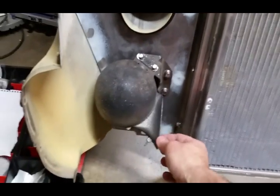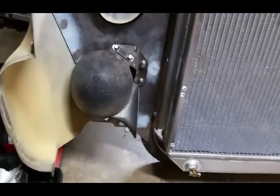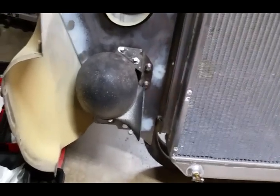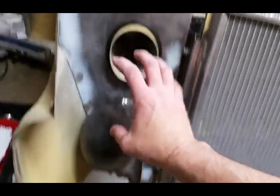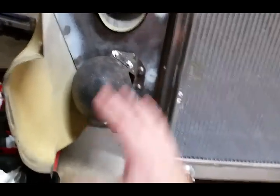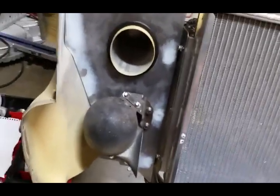These are actually off a four-door car I had — very nice and they still work. In reality the car's getting its voice back because these horns have their own sound. If I'd have put on an aftermarket horn it would have sounded like a foreign car or a boat. The problem I ran into originally is the horns go up higher and I've got my cold air pipe coming in there, so I had to drop them down. The bad part about dropping them down is you'll be able to see them through the grill, but that doesn't really bother me — it's kind of original.